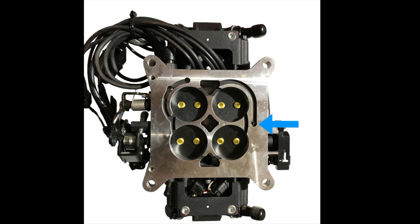Right here you have the MAP sensor port. This is where the divider in the intake manifold would sit. It has these two channels to read vacuum equally, and it runs through this channel here to the MAP sensor.